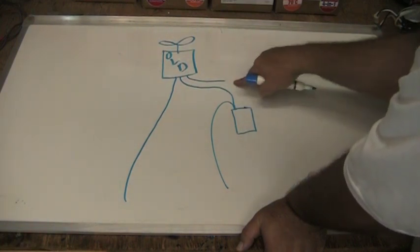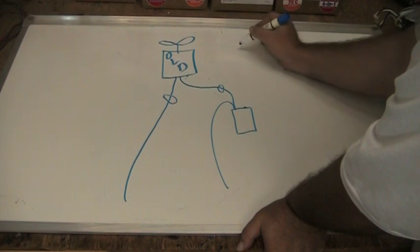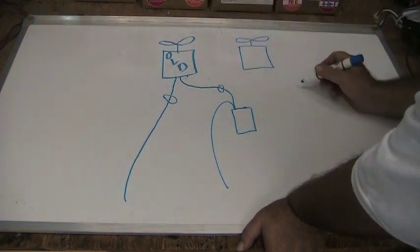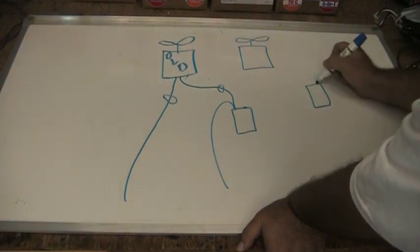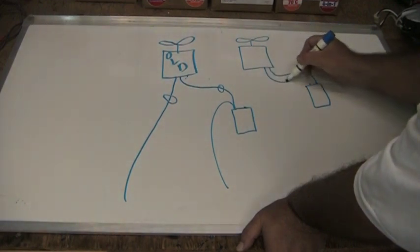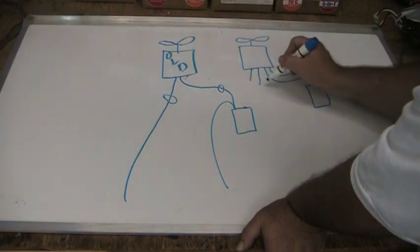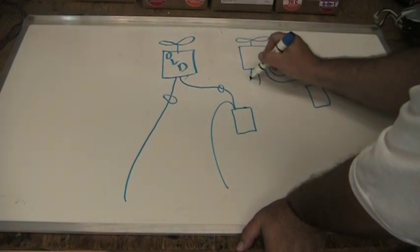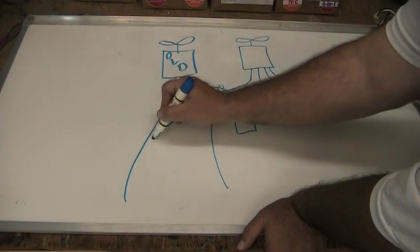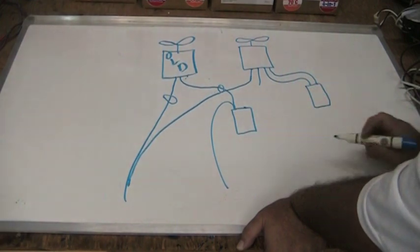We're going to eliminate that capacitor wire. The remaining wire is our power wire. When we put in our new motor with the fan blade, it has a little capacitor — one brown wire goes to one side and one brown wire goes to the other side. Then we have two power wires coming off, a black and a white one. We simply follow each power wire back to wherever it goes and unplug the old wire, then plug in our new power wire.